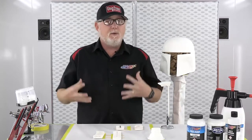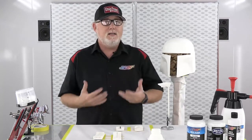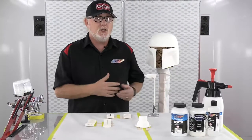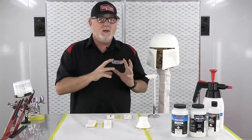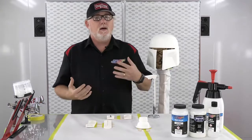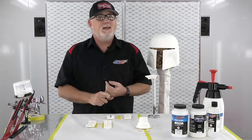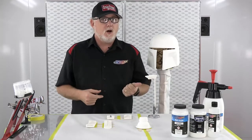A lot of people put a polyester primer on top of this, what we call a DTS or direct-to-surface primer. We don't really need to do that here because it doesn't need any more sanding — it's actually in good shape. What we are going to put on is an adhesion promoter sealer to make sure we lock everything down and give us a good surface we can mask and paint on without any lifting. The best materials to work on — not just resin, but urethane, acrylic, polyester, aluminum, fiberglass — some of the best stuff I've ever used is the new Createx.